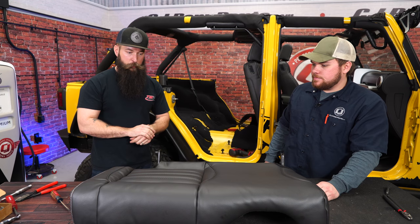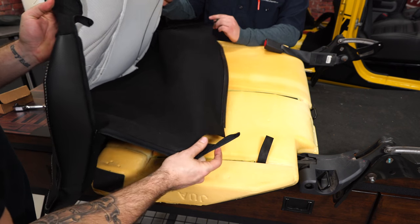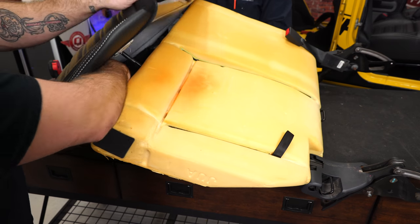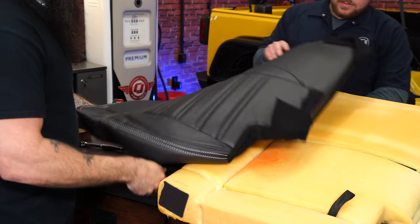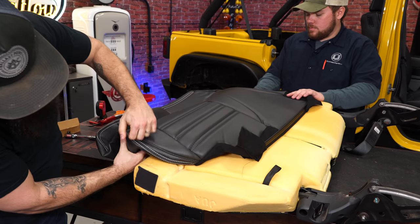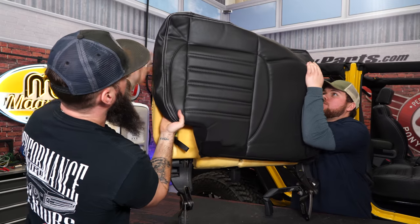The foam is going to want to fight you a little on the back side. With a little massaging and a heat gun if it's too cold, it's all going to smooth out just fine. For the larger section of the rear seat back, the listing rod is at the top of the seat with Velcro down each side. It's such a large piece that needs to go on first — you can't do the hog rings until after you've slipped it over the top. Feed the seat belt up through the top so it's ready for the center seat. Align the upholstery to pull the headrest posts through as you start to slide this down around the back.